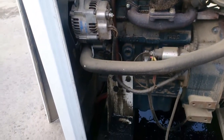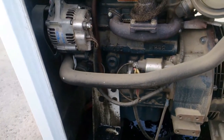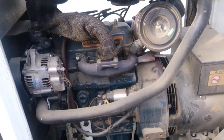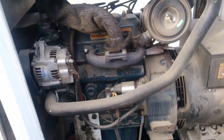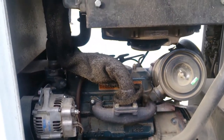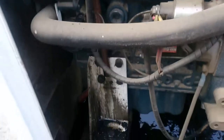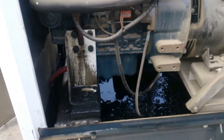So how many years has been taken off this engine, don't know. I did find out yesterday that the reason the radiator isn't choked is because some months ago this engine was overheating and the guy, thinking it was the radiator that was the sole problem, swapped out the radiator. But you can see by the layer of oil on the fan blades the thing was well choked — because of oil fumes from the engine being cooked.